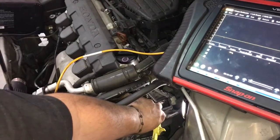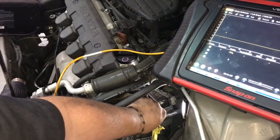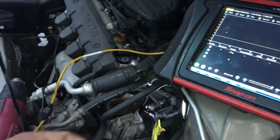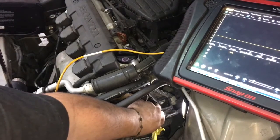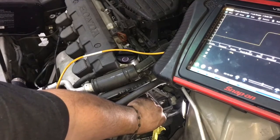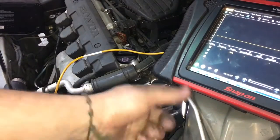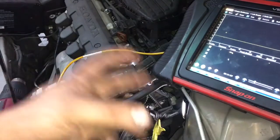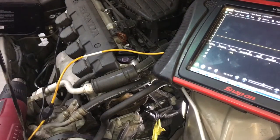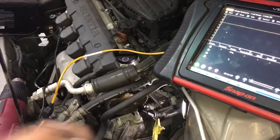Right there you got 0, and we're going to try to get 5 volts. Because remember, this cam sensor right here is a magnet. Every single time you touch metal it grounds out right there. Without touching metal or any surface you're going to have 0 volts. As soon as you touch it's going to make contact and we're going to get 5 volts. So what we're going to do, we're going to stick this in the position where it's touching metal the whole time so we can get that 5 volts.